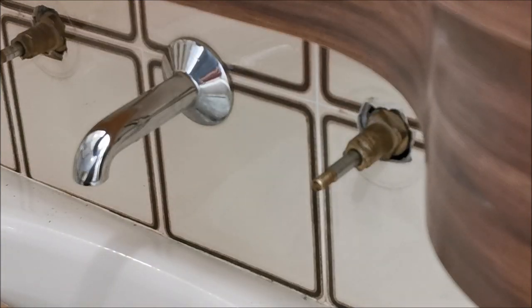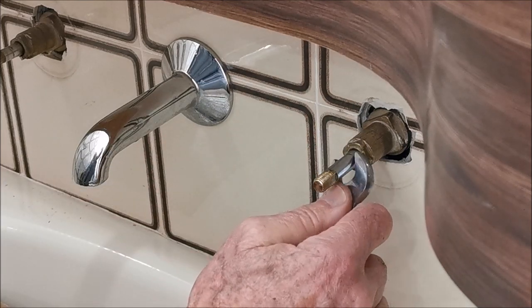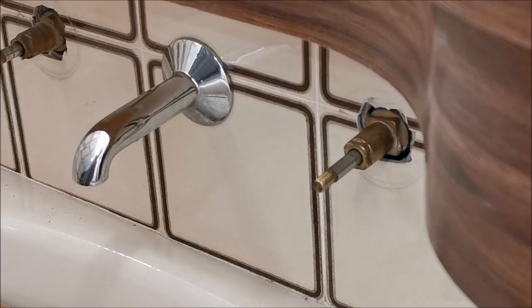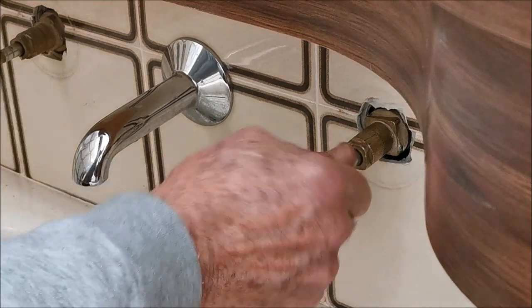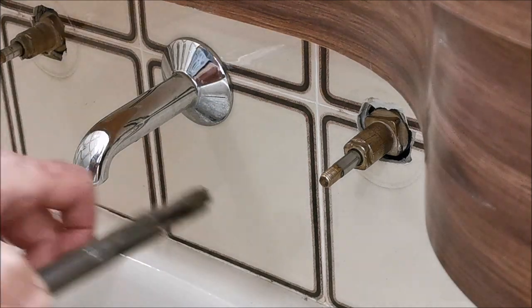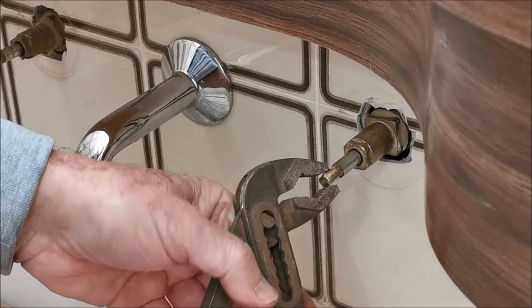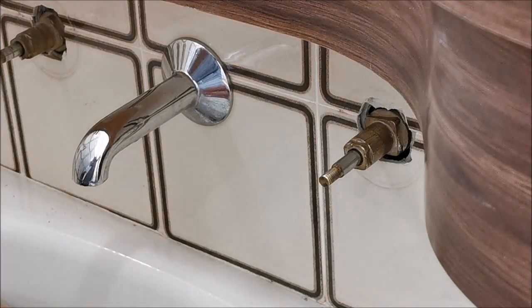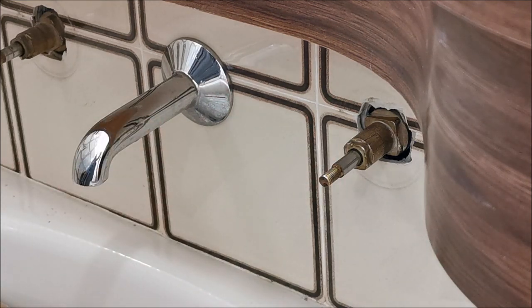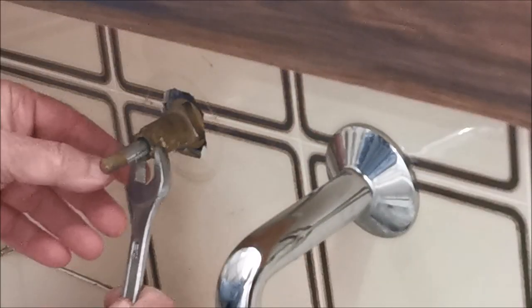Be careful about your tightening - you don't want to over-tighten it. Just a little bit of pressure is fine. Then screw it in until the washer seats and seals so that when you turn the water on it's not leaking. Leave it just like that so we can check for any leaks. If your o-ring is leaking you'll normally get a drip from the stem area - that's a sign to replace the o-ring. But if you're undoing the tap anyway, you may as well replace it. The other tap is exactly the same.